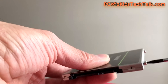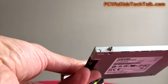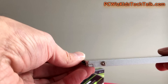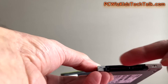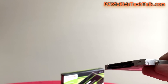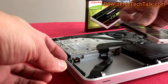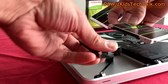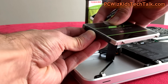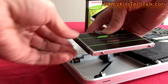I'm using the screws that were attached to that Hitachi hard drive. I just took it out and attached these screws onto the new TR200 SSD because it comes standard with the right size holes, so you can just replace it. Same SATA plug, so you don't have to worry about the connections — it's going to work. Depending on your laptop, the connector will look a little different, but it's going to plug in no problem into the standard SATA connector on the TR200.